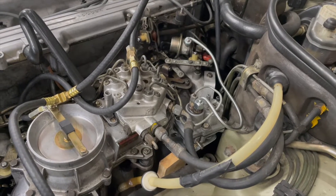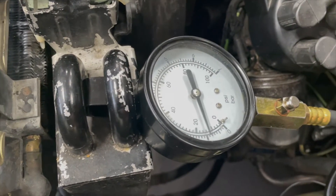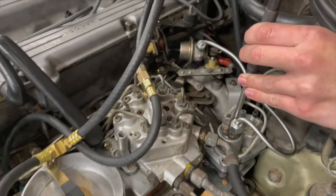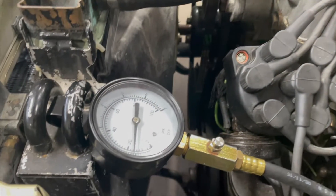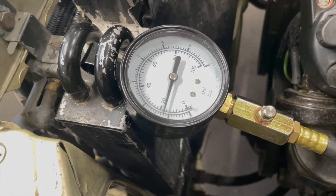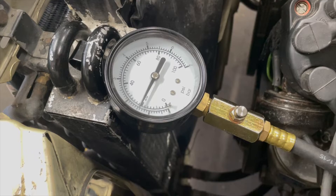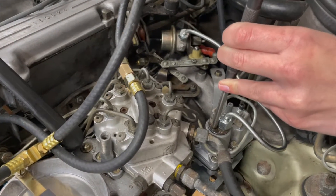Mercedes did this on the bench. Watch as we tap on the fuel cell — we're going to tap down on it right now. Our pressure is about one bar. Then we'll go back and start tapping. Watch it come up as we tap, moving side to side. The goal on the initial adjustment is to get up to about two bar, so you keep tapping on the fuel cell side to side, just light taps side to side.